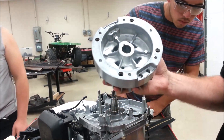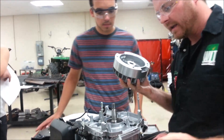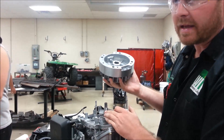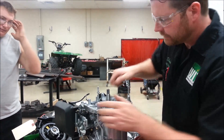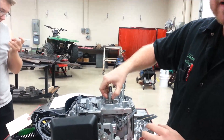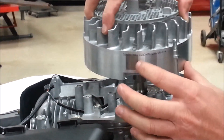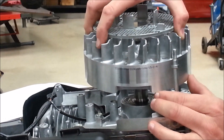I'm going to lift the flywheel to show the keyway. We want to make sure there's no grease in here whatsoever — this needs to be dry. The shaft itself needs to be dry. You might see on your training engines a smear of oil or anti-seize, but in the real world, on a tapered shaft with a keyway like this, they need to be spotless clean. That keyway is what sets the magnet into the right position to fire the spark just before top dead center, like we covered in the classroom.